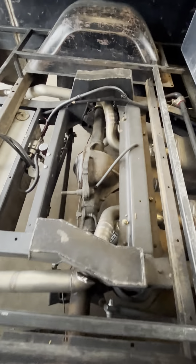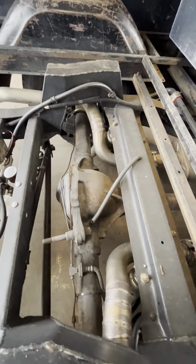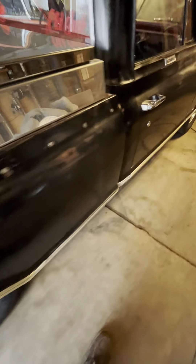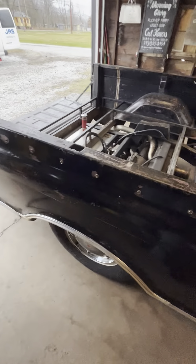The aluminum fuel tank has an inline filter, inline pump, check valve, rollover valve, and a check valve for the supply line — basically a sump, because the tank was supposed to be baffled and it was inadequately baffled. I would starve making right turns, so that was what I came up with instead of cutting the tank apart. My brother is a professional welder and TIG welded all the exhaust. I have some pictures of that before it went in. And here we are back where we started — I hope this works, because I will be very annoyed if it doesn't.